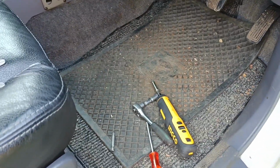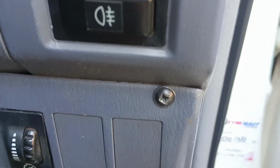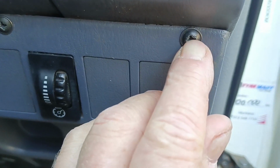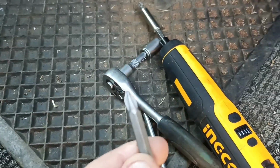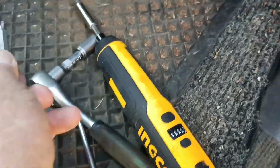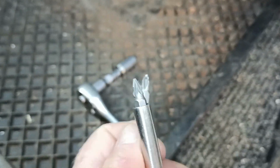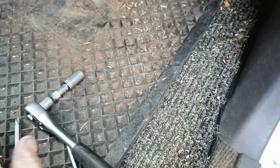So we do that. Window, door, make sure everything's clear here, because that's where we're going to put our screws down in order. We're going to look at the screws themselves, and you'll see over here they've all got these little lines in between the grooves. Looking at the size and those lines, we are not dealing with a Phillips head 2. See, they don't have any lines. We are dealing with a Pozidriv 2. Can you see the difference in the bit? With these little triangles coming in here, they're going to fit better and not make your life so miserable.